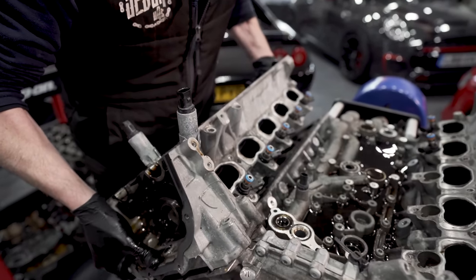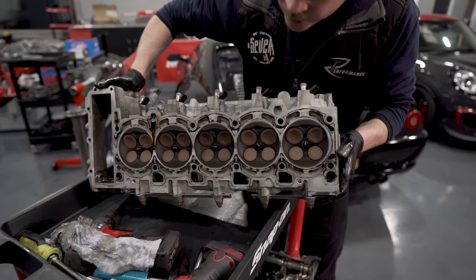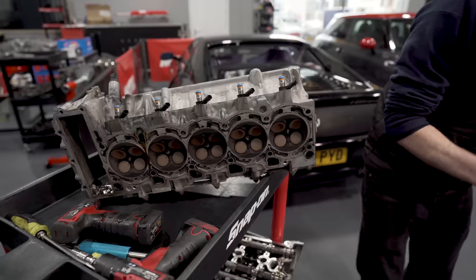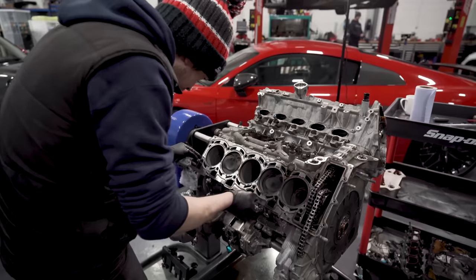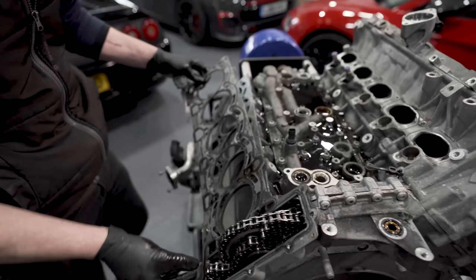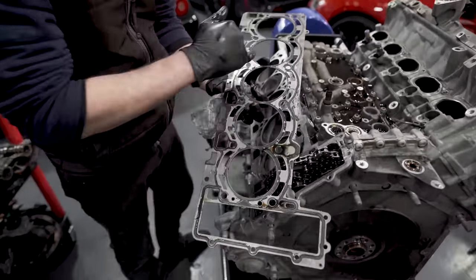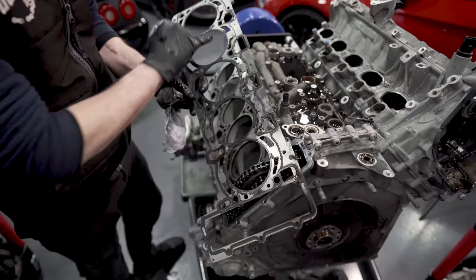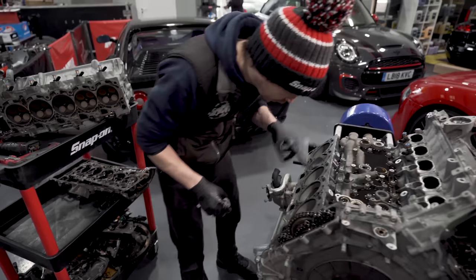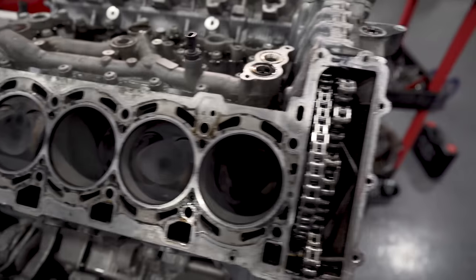Right, one, two, three. So, brown valves. Hey, if that doesn't tell you it's running on race fuel, nothing will. No obvious signs, look, no staining, no blow by. You'd get clouds if it was. No colour. The bores look good. We can only see three of them, but if you look down, you can see there's no big scuffing. Everything looks pretty clean. Good stuff. So that's okay.